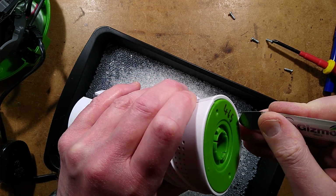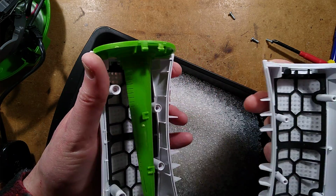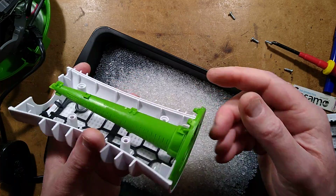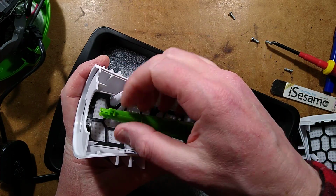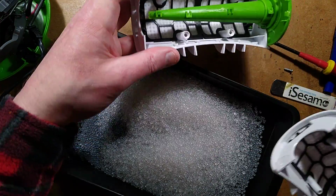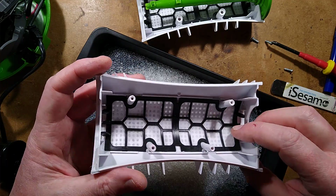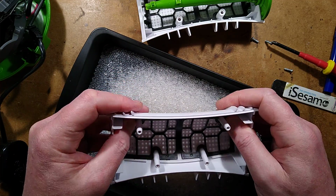Right, tell you what, spudger. That's promising. Yes, that is promising. So what do we have? We have the air port that guides the air up from the base here, and it's conical, and it's got little slots all the way up it to spread the air consistently across the whole block of gel. It's also got these screens in here that are designed to allow the air to flow out, but not let the fine dust of the silica gel come out when it eventually breaks up, which it always tends to do. But that's more or less it.